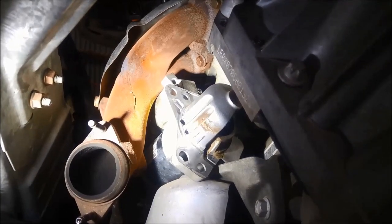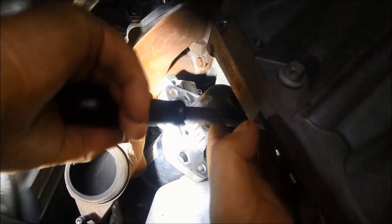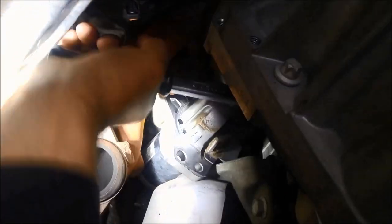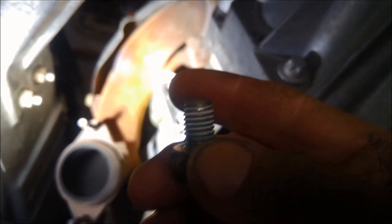Using a long 18mm socket to find the head of the bolt. To spin the torque converter around I use a screwdriver with a bent end that you can just lever off the bell housing. When doing that, always be aware you could damage something so double check before you do that sort of work. These bolts have Loctite on them so they'll be a little difficult to undo. Once you get the converter loose, push it into the transmission - we remove it with the transmission.